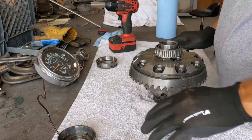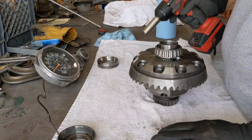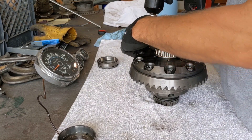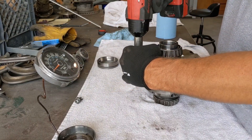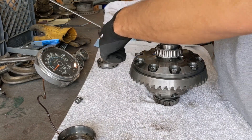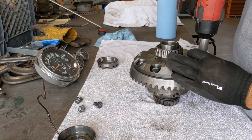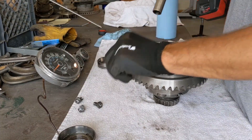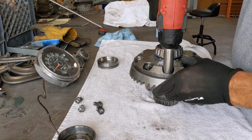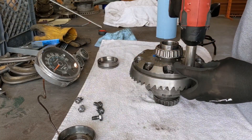Pulling this apart, we have to take the ring gear off first. As you can see, I had marks on the bolts to tell me the tightening sequence when I was doing this gear job — that's why those are marked. The easiest way to get a ring gear off is with an impact wrench. If you don't have one, it makes the job a little tougher but not impossible — you just have to work your way through it. You're going to have a lot of gear oil in all this stuff, so you'll have to wipe all that up too.